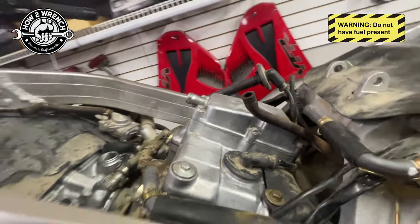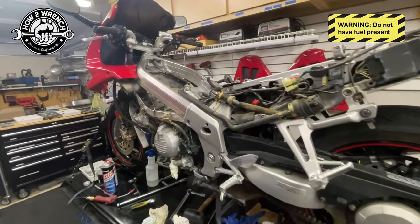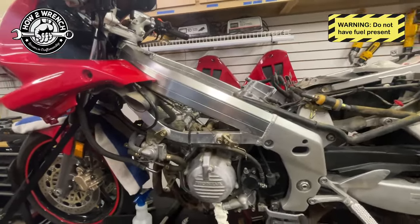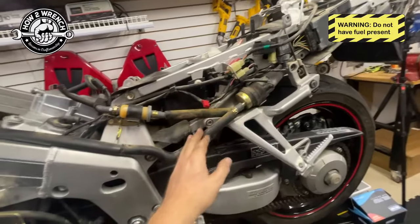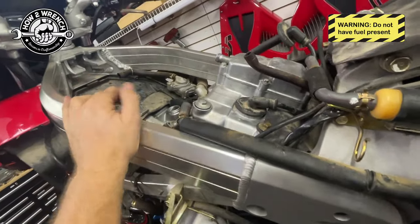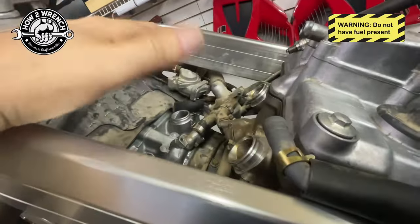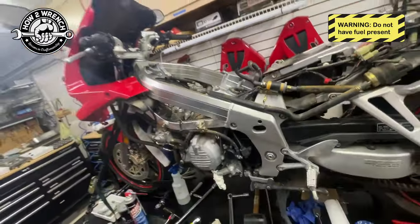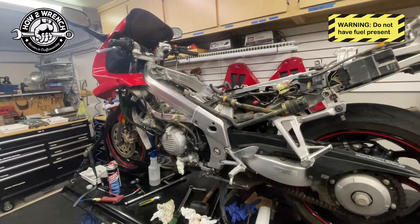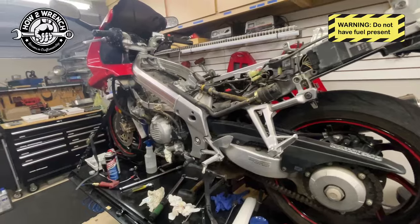There's a lot of science and engineering that goes into all this, but that is another little bit of insurance you can buy yourself before you button it up so you don't find things out the hard way. A couple of safety notes: this bike has a fuel pump and I have it disconnected, so I have no fuel sources that could cause trouble. Once I'm done, the intakes are going to get covered back up so I can keep working and not take any risk of things falling in there. There's a lot to being a technician — if you're doing this yourself and thinking 'to heck with this, I'll pay somebody,' now you know why you pay them.